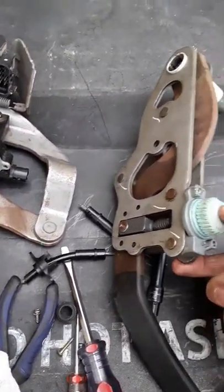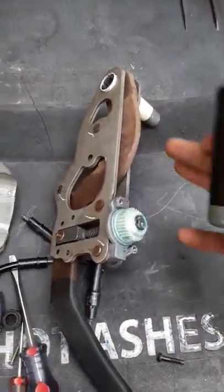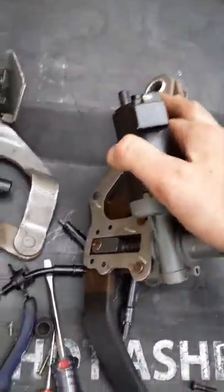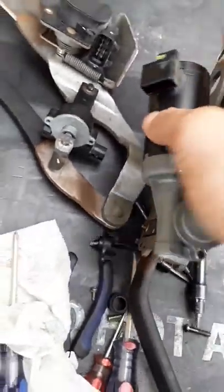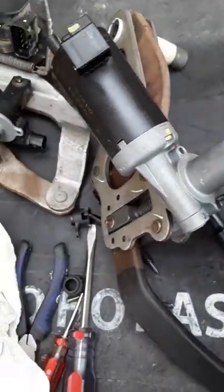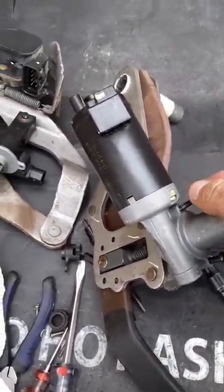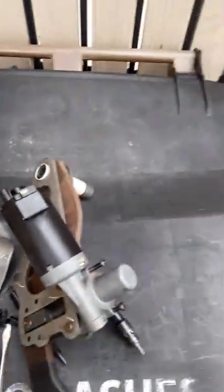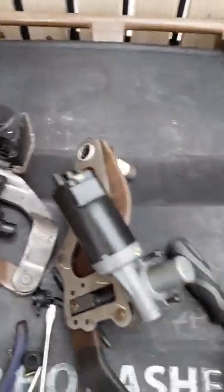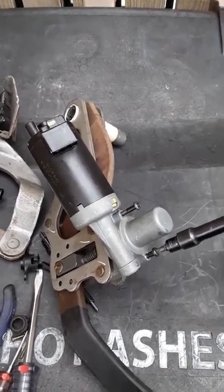There are no videos on the internet about this little fix. So before you take the whole entire thing apart assuming it's the motor — the electric motor — just take this apart first and it might save you a bunch of time. Do it for me, because I'm just taking this whole thing apart and it took me five hours messing around with it. So check that plastic gear.